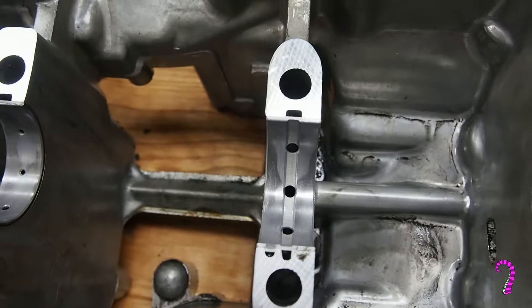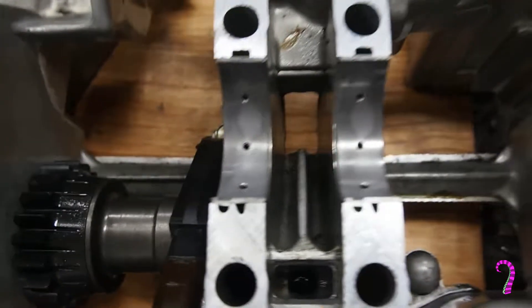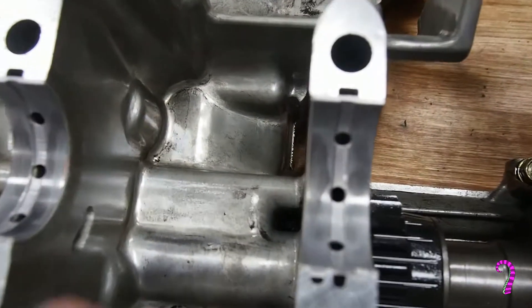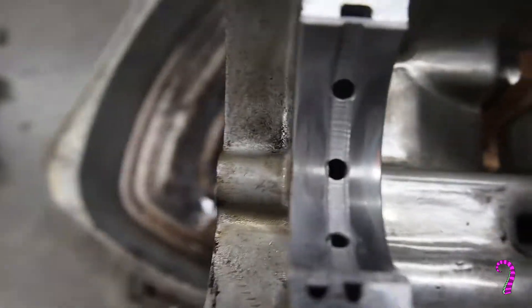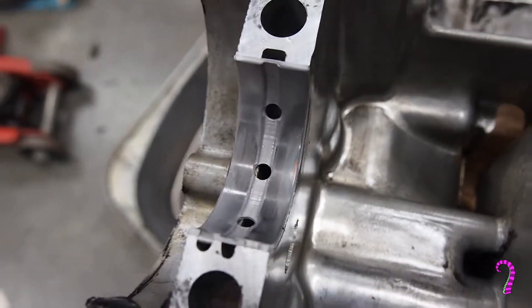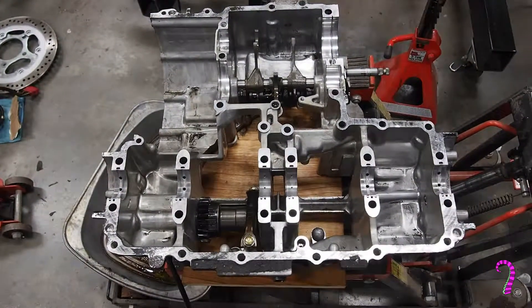What sealed the deal was looking at the lower crankcase half. This one, again, has quite a bit of polishing — likewise for this one. Nothing that really catches your fingernail though. These ones are in good shape; you could theoretically reuse them, but it's kind of a false economy. That one's a little polished, but here's the one which I'd say is worst of all — you can actually see where the metal's worn down enough that you can see the copper behind it. So yeah, these would definitely be replaced. Normally you'd take a bearing clearance, but I'm not even going to bother — I'll just go order the parts.